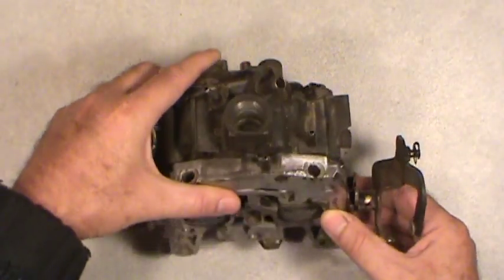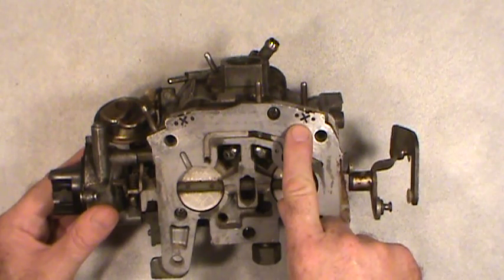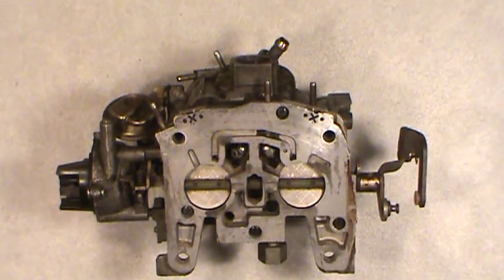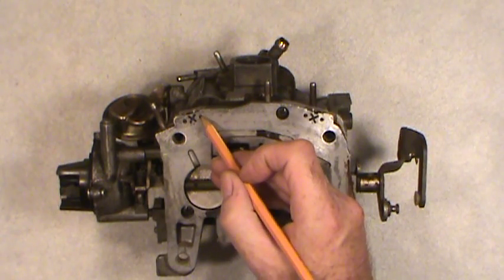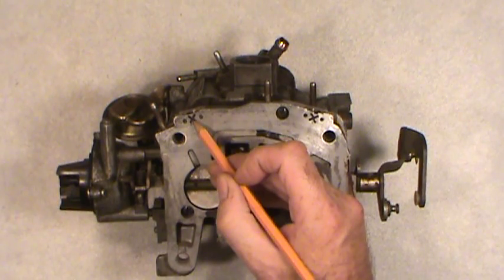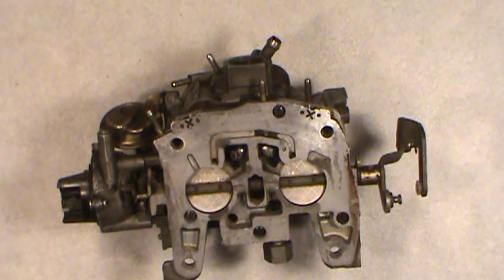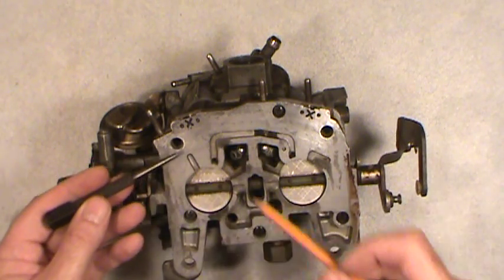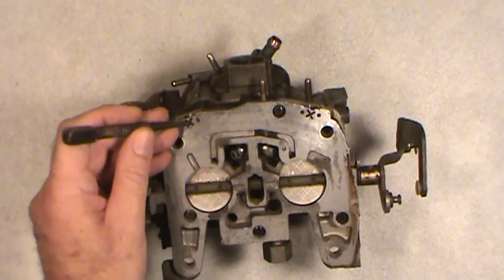I'll flip it over one more time. You'll notice here I've used a small felt pen to mark two little divots or recesses — guide marks that are cast into the bottom of the throttle body — and I have an X in between. X marks the spot, kind of like buried treasure, but in this case it's where you've got to basically get a hammer and a punch. This is what one of the rebuild kit instructions recommended in order to get this hardened steel plug out: you actually have to destroy part of the bottom of the throttle body. What they wanted you to do — from what I recall reading — is take a punch, go between those two dots, and hit it a few times.